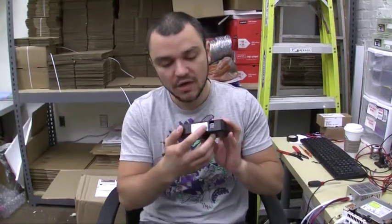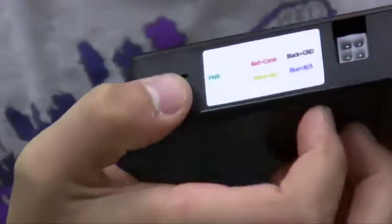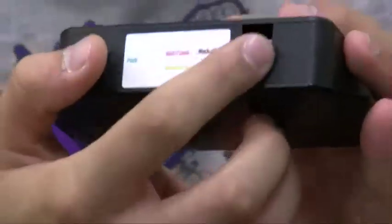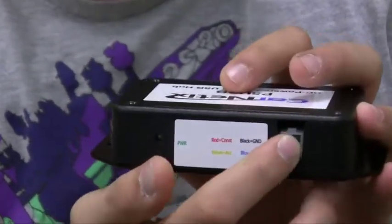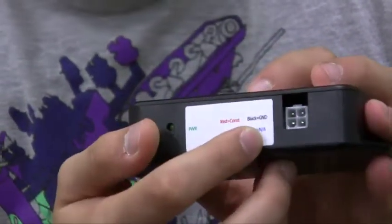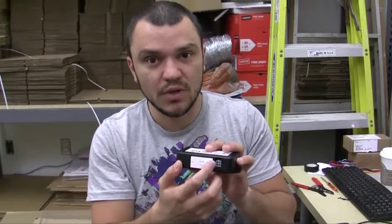Here on the back of the hub, there's the label and there's an LED to the left of the label, which lights up whenever the hub detects power from the power molex connector, which means it's connected to your battery. The 4-port power molex connector is a snap-in molex connector, which means it's not going to get loose very easily whenever the hub flops around in your trunk. The label describes what the 4 wires on the molex connector do.